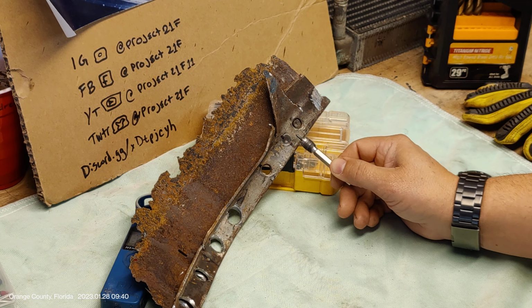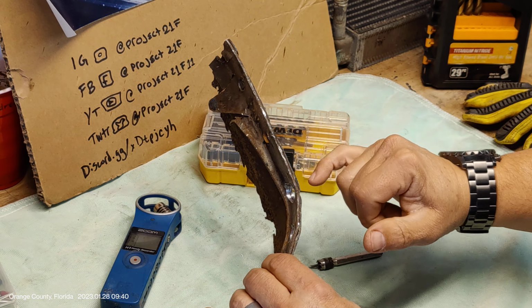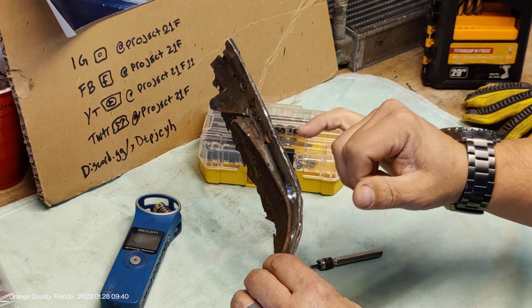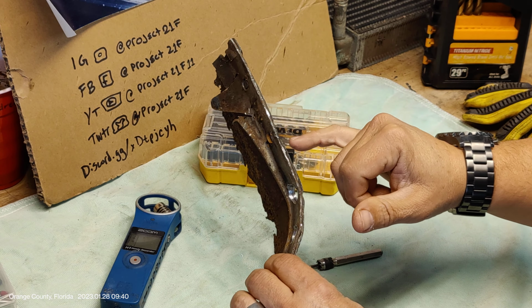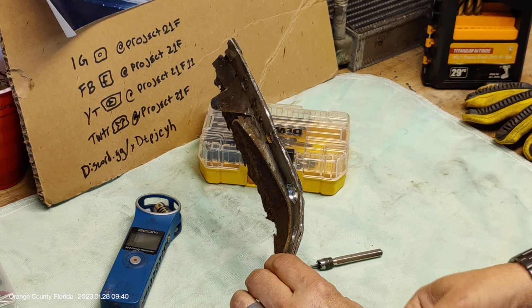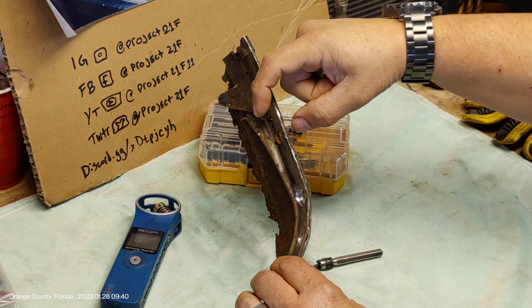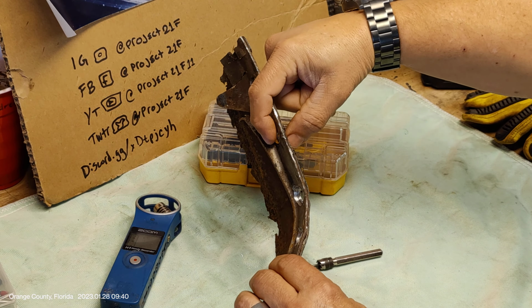you have the inner rocker and the inside of the car. You have the outer rocker, and then you have a center additional layer that is not present on a coupe or fastback. But you have this whole other panel in between the two that gives it additional strength. So you have 3 sets of steel that are being bonded together with a pinch weld.